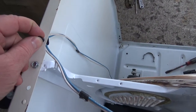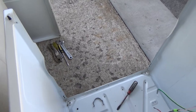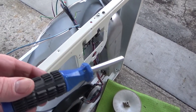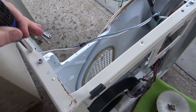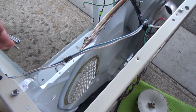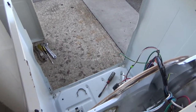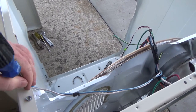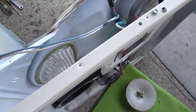These clips I just left on — this is eventually going to go to the dryer switch. A tip for taking these clips out: a quarter-inch socket will fit right on there. Push down — a quarter-inch will be almost perfect for taking those out. You can try a slightly smaller metric if that doesn't work, but twist it a little bit and push down while doing that. That helped get those out a lot.